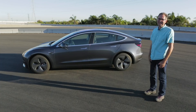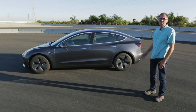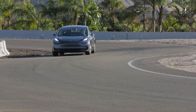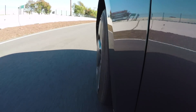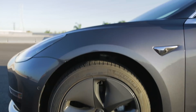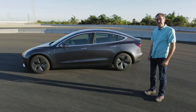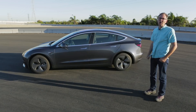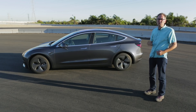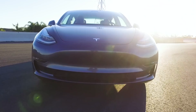My average after those laps is 1,042 watt-hours per mile for sustained lapping. That's a lot of fun — there's plenty of thrust from this 258 horsepower electric motor to really get your attention on the straightaway, and it comes out of corners really nicely too. Tires are another story — I wish there was a little more grip, but that's partially our fault. These are the 18-inch base fuel-economy tires. If performance matters, the extra $1,500 for the 19-inch summer tires is probably worth it, but if you're into efficiency and maximum range, the base tire is the ticket.